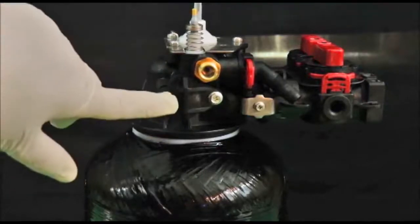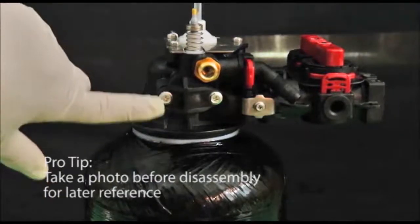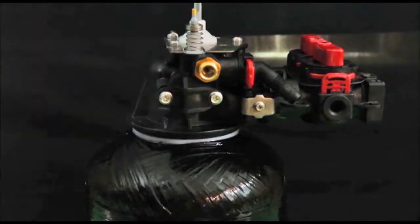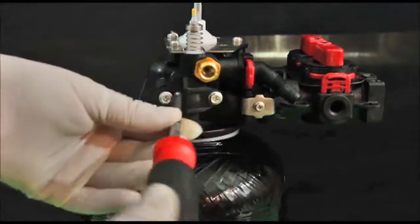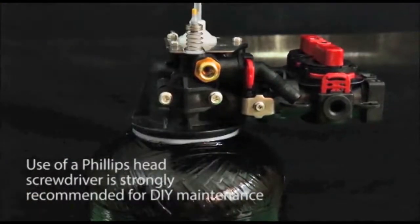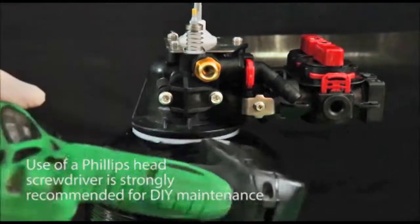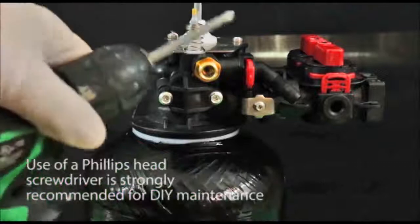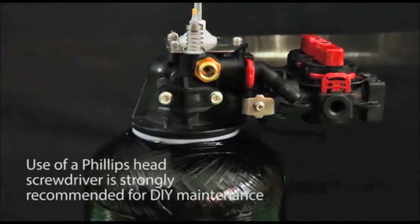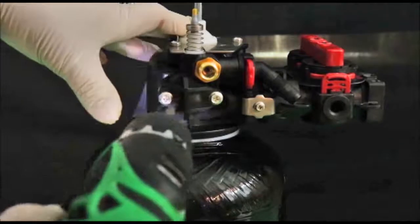This is the cap. I'll take out this 5/16th bolt here and here. They also have a Phillips head slot in them to make it easy for you — you can either use a regular Phillips head screwdriver, or just use a light drill. I'm using a light 12-volt electric drill with the torque setting at 50%. I'm working with metal bolts in a composite material, so I'm setting the torque down so I don't strip anything out.